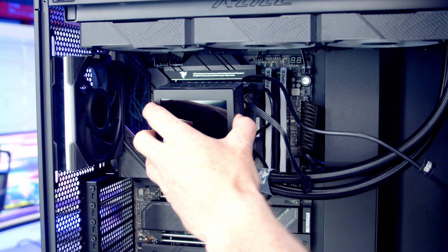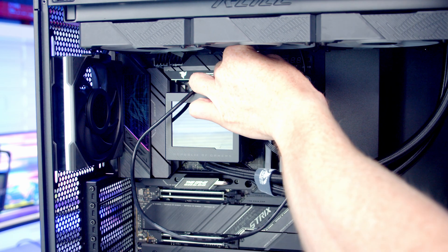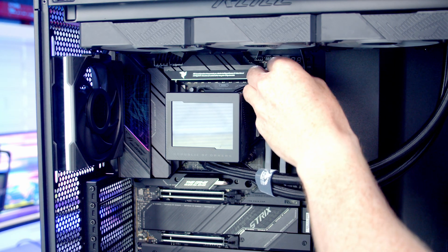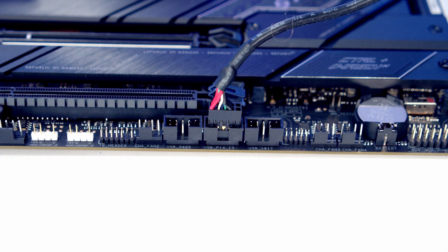Return the pump screen. Pull the excess USB cable up toward the top of the case and pass all cables through to the back. The AIO pump header is the one at the far right at the top — plug the PWM cable into it, bring all excess cable through to the back, then plug the USB cable in at the bottom.